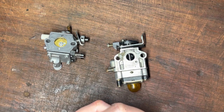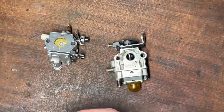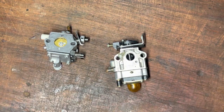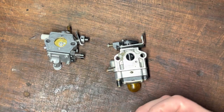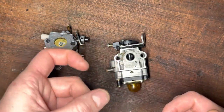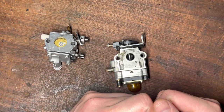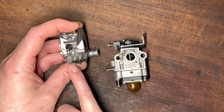If you've got your engine started and you're pulling that trigger but there's a bog — every time you pull it, it almost wants to die and it stutters — eventually you might get to wide-open throttle, but there is that bog. Or you might have to flutter the trigger slightly and pull it a couple of times until you get enough fuel. That is a lean symptom on idle, so that's the low-speed screw again.